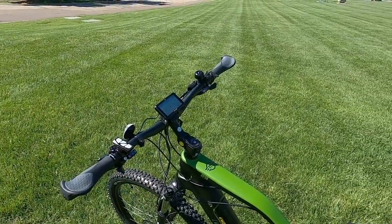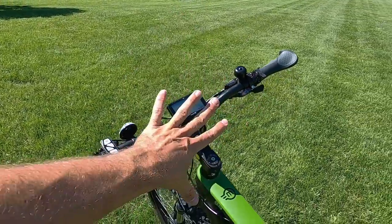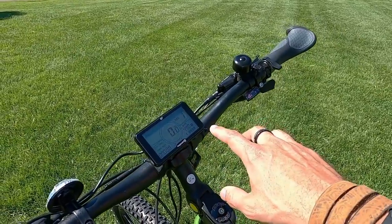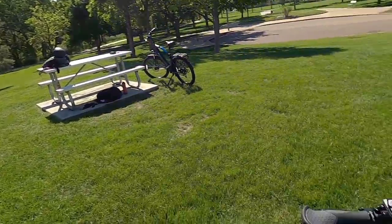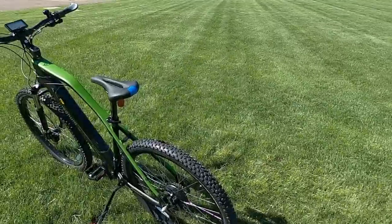The bike is pretty well tuned right out of the box. You get full power assist at any pedal assist level — it doesn't matter if you're at zero or level six, the throttle is always the same and caps out at 20 mph. For pedal assist, each level essentially sets a speed limit: level one cuts motor assist at about 10 mph, proceeding upward until level six gets you to 25 mph, which is about the natural limit of the motor. You can pedal past that with the gears available, but it'll get considerably harder on a 60-pound bike.